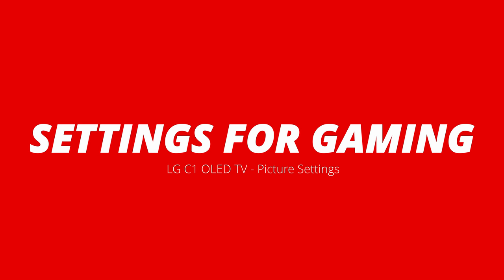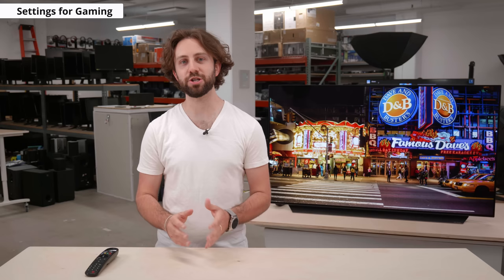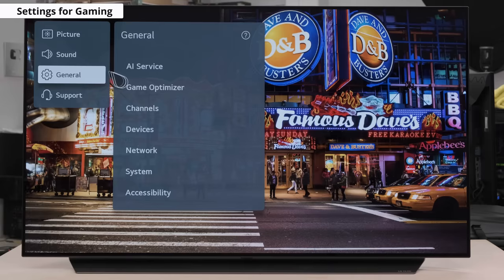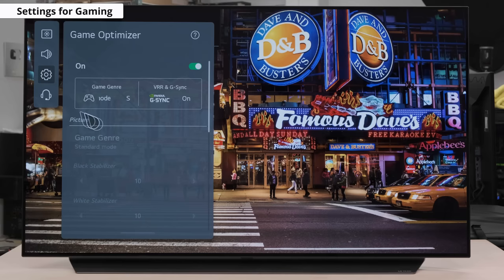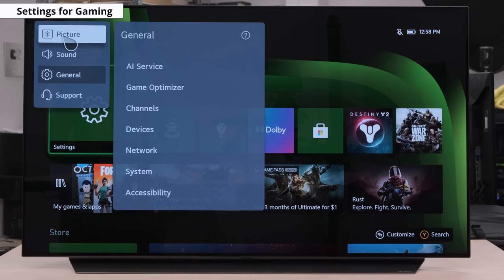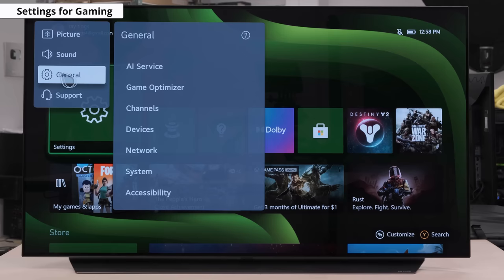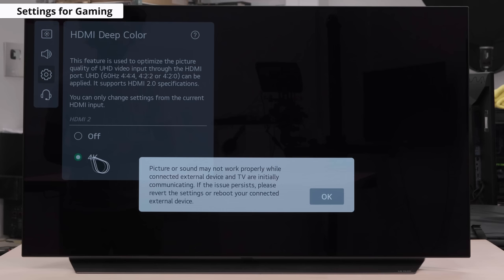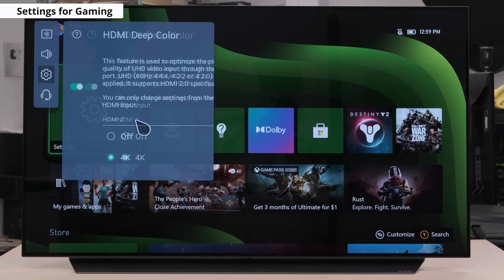The optimal gaming settings are pretty straightforward. LG did make it much easier to change up your gaming settings. What we recommend is mimicking the settings from HDR and SDR content and making sure to enable the new Game Optimizer option in the General Settings tab. This will allow low latency mode, allowing for a great gaming experience. If you were able to get a hold of the Xbox Series X or PS5, you'll be able to take full advantage of HDR gaming with content at 4K 120Hz. You'll notice the C1 automatically enables all the game-related settings and should switch over to Game Optimizer picture mode when you choose the input your console is connected to. You'll also want to enable HDMI Deep Color on the console's input port to maximize your gaming experience. Check and be sure that Instant Game Response is enabled so that the TV can automatically enable the Game Optimizer features for you.